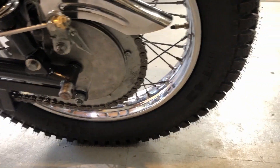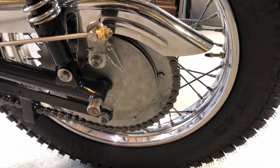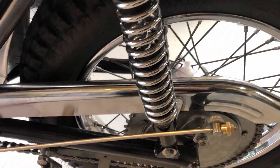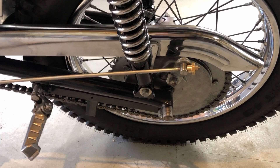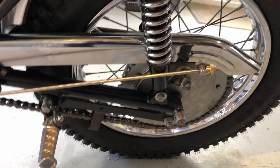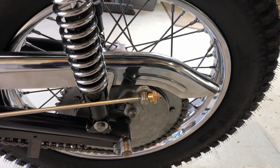I'm not sure yet whether this sprocket will do for road use without a speedo or rev counter to know what it's doing - I might have to drop to a smaller sprocket. I struggled to find an original chain guard for the B50 Victor, so in the end I used one off a Royal Enfield - fits quite nicely with a few modifications, just a bit of drilling and bending, no welding, and no problem getting the wheel on or off.